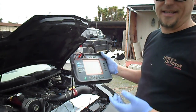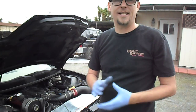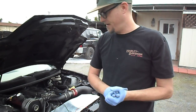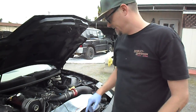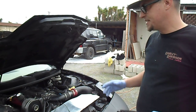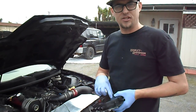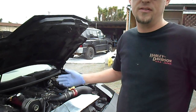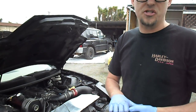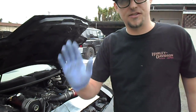Since it's OBD2, you cannot get the OptiSpark signal from the OBD2 port. That's my video — I hope it helps keep those LT1s on the road. To summarize: use the Mitsubishi sensor, a new bearing, cap and rotor from the API unit. The OptiSpark is notorious for stalling. If you use the Chinese sensor, they overheat and you'll be stranded, and then all of a sudden it'll start and run fine again. Go with AC Delco reman or use a Mitsubishi sensor with a different cap, rotor, and bearing. Thanks for watching.